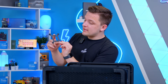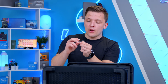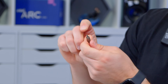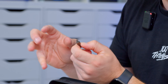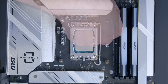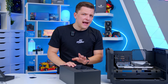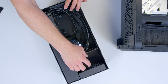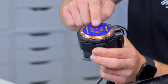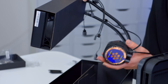Next up is the CPU cooler. I'm using the included backplate to brace the cooler in, followed by the posts which screw into the backplate with a female thread on one end and a male post on top to secure the water block down. I always try to do the CPU cooler prep as early as possible, as doing it later makes life unnecessarily more difficult. The cooler comes packaged really nicely — all the installation hardware in separate AMD and Intel boxes, the CPU water block itself which looks really nice, and the radiator with fans all pre-assembled in cardboard packaging. Not only is this more eco-friendly than a plastic bag, it also protects the radiator fins from damage.